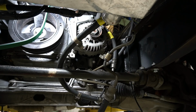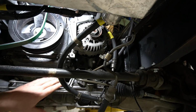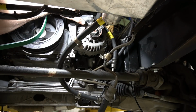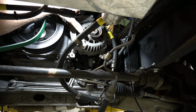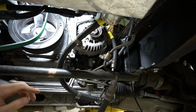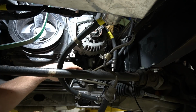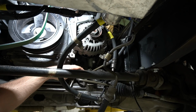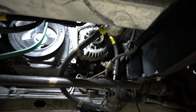So this is my theory on how I'm gonna make the power steering pump connect to the Ford Crown Vic rack. Keep in mind, this is a pump out of a 98, 99 F-body car. So somehow I got to connect the pressure side of this pump to actually run into the pressure side of this power steering rack. I bought an adapter piece to actually tie an AN fitting onto, we can't see this.